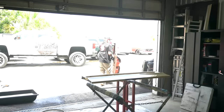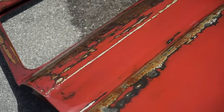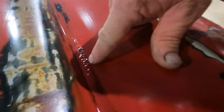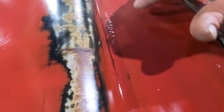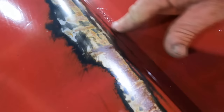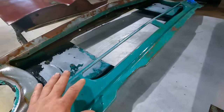Here are our finished products — I'm pretty stoked on the way it turned out. This was our raw metal door and it was a completely manufactured faux patina. There's one area where using aerosol cans the different chemicals reacted and I got a little bubble, but this happened to me on Cha-Ching too — I just sanded it down and left it, and it just added more character. Don't be afraid of that kind of stuff.